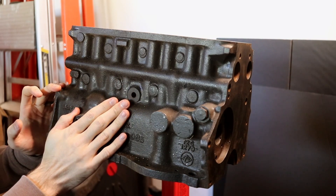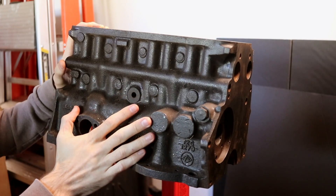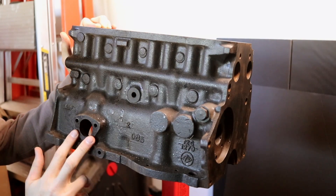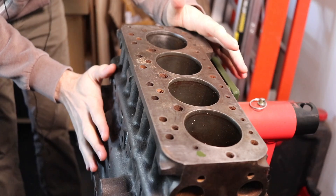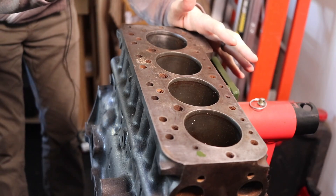Let's take a look at the block that I got in the mail — the one that is going to be getting the forced induction build on it before I reveal what I'm doing. What we have here is a 1275 GT block. That is a 1275 displacement, it's not been bored over, it's completely bone stock standard, and it's a pre-A plus. You can tell that because there are no tappet covers on the back. I also wanted it to be bored up to 1293.